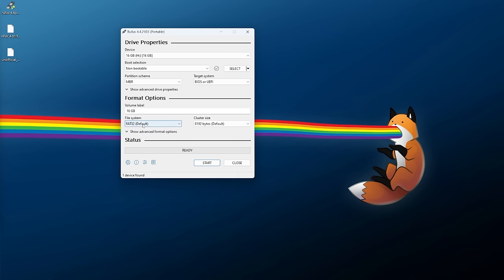For the first install through the XMB, make sure your USB drive is plugged in, navigate to Settings, go to System Update, and select 'Update via Storage Media.' Once it finds your HFW, tap OK, wait for it to load the terms of service, accept, go to Start, and tap X. Give it a few moments to copy over. It'll reboot and then update. If it jumps to 100% and reboots, that means the firmware installed successfully — that's expected behavior.